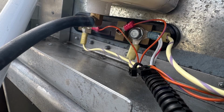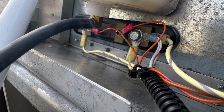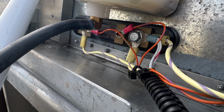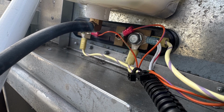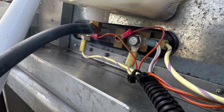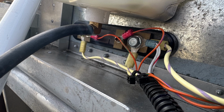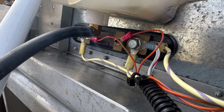Steve and Ivy, they have a great airplane. We did, however, find a couple of little things here and there, and the shunt was measuring all kinds of erratic amperage, so we got that all fixed. There ended up being a little wire to the shunt that was just kind of dangling and making its contact when it wanted to.